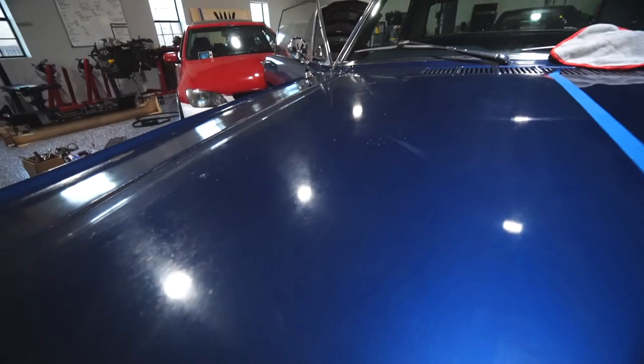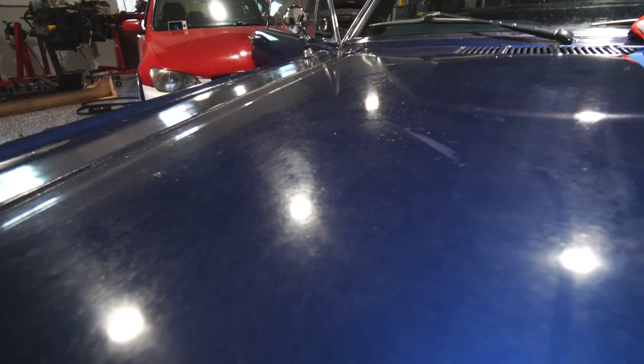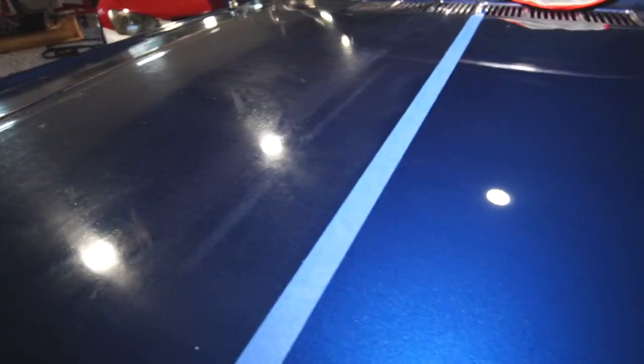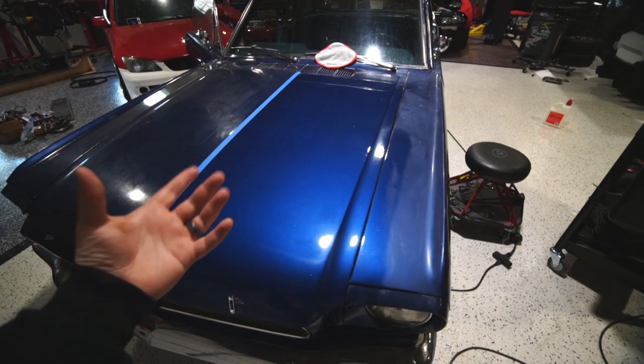Now we're off to the fun part. I had a few ideas on how to get this paint back to normal. Victoria washed it, I brought it in, and I did clay bar the car — it was moderately effective. Since I'm going to be doing so much, I just wanted to get everything out of the paint that I could. I've gotten a chunk of the hood done. I wet sanded and — look at that, y'all. I'm pretty confident I can get this paint looking at least decent.